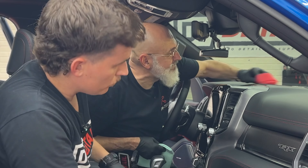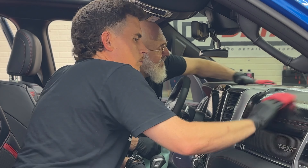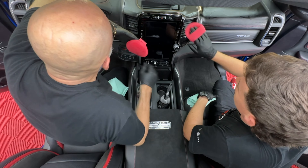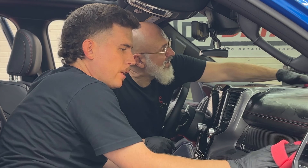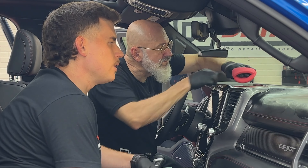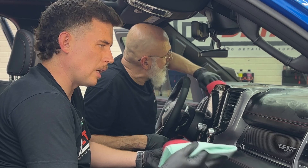On the Alcantara, I'm not going to be wiping it off — I'm just getting it in there. On the rest of it, I'm leaving a bit of moisture behind. I'm going to wet my pad a little bit more because the Alcantara drank it up rather nicely. This might freak some people out if they've never applied a coating before, but nothing to be afraid of. You can smell the solvent, so wear a respirator if you choose — it's a potent chemical. Use some safety precautions: gloves, a respirator if you'd like.